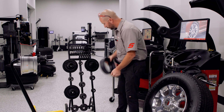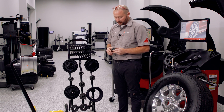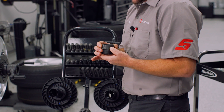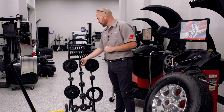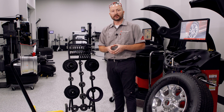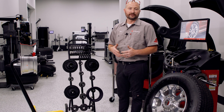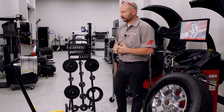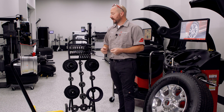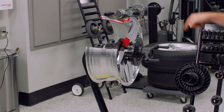We want to show you what using ideal tooling looks like on something like that. Let's take a look at the collets. The nine-piece collet set offers pretty global coverage - it's double-sided, so you have 18 ranges, starting out somewhere in the 50 millimeter diameter range. That's a great way to emulate that hub-centric taper for a wide variety of vehicles versus using four or seven cones with a very steep taper. It's just a much more precise approach. The next benefit of using a collet I'll show you up close on this cutaway wheel - that is their shallow nature.